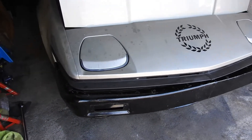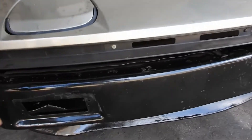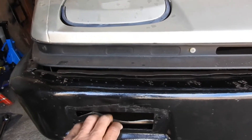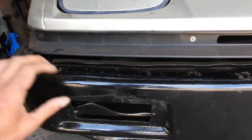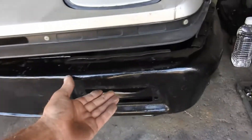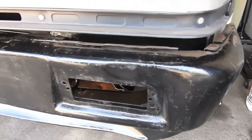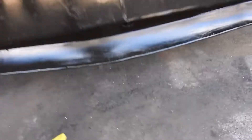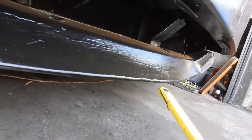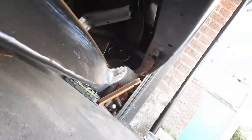The car's a bit dirty, please excuse that. With the main body you've got the impact bumpers, and basically the plastic comes out over this — but what you can do is pull this out a bit. This side is completely okay. I'm not sure if I'll be able to show you that, but the rear bolts securing it to the main front chassis members or the body members have actually split.